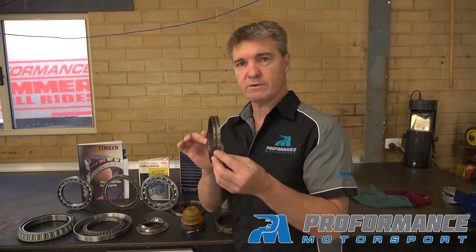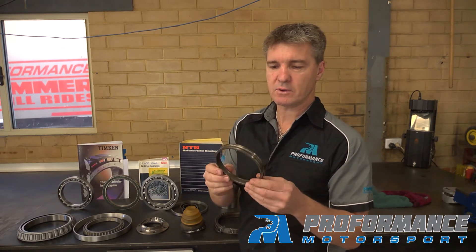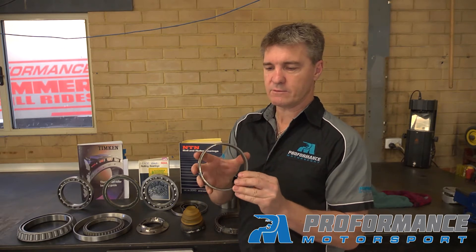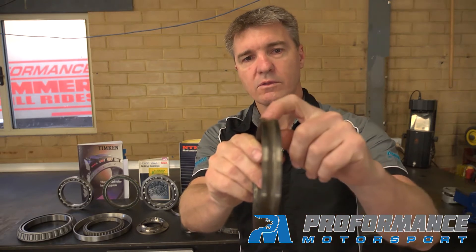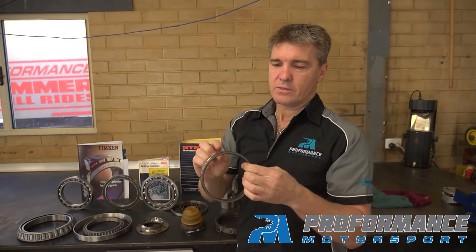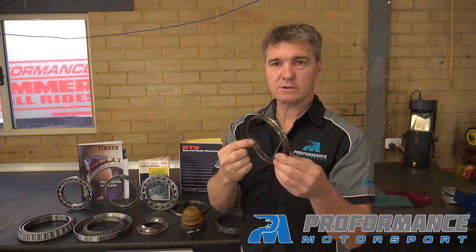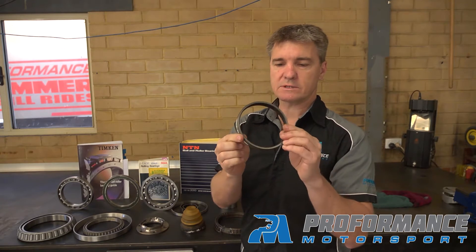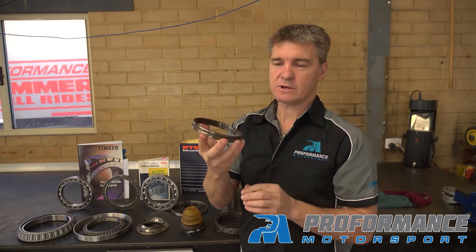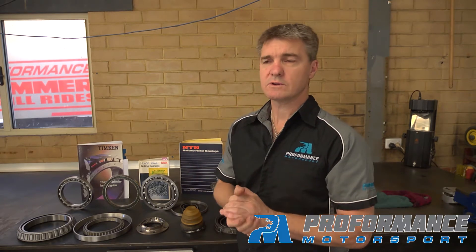Here's an example of one of our transfer case bearings — a very early design. We made the transfer case incredibly light, no splines, nothing to break. Unfortunately, the bearing is very, very small. You can see the size of the ball bearing in here. The rotational speed of that ball was so high that the bearings were turning blue every time we hit about 100 to 115 miles an hour, maybe 120 miles an hour. After about 10 minutes of use, the transfer case would heat up and we'd end up with a very, very hot transfer case.